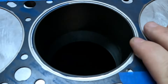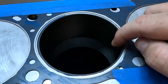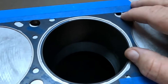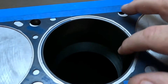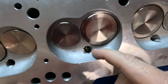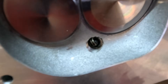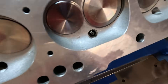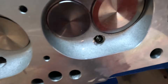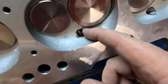These marks represent where the top ring land will actually be. What we're going to do is bevel this edge with a Goodson sandpaper roll to mimic what we would actually do in the block. Now, I do not like these threads right here — the sharp edges. That spells a recipe for detonation. So we're going to have to enlarge this chamber to get some better flame travel.